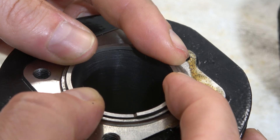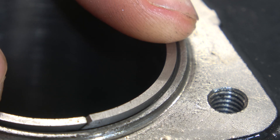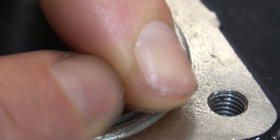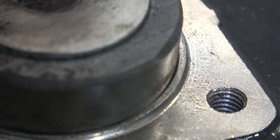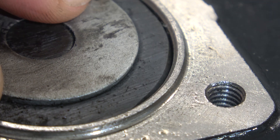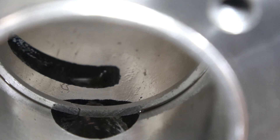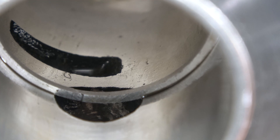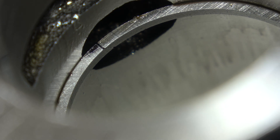This is also normally the way you measure the piston ring gap. To press it down to the port I use a piece of plastic — this way it's perfectly aligned all the way within the cylinder. Going down, you can see the piston ring gap over the exhaust port, and this is exactly the problem that could arise.